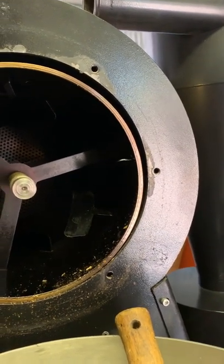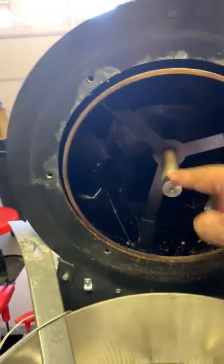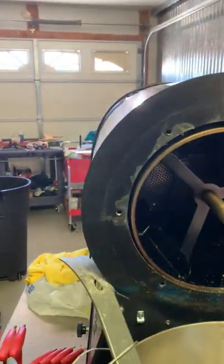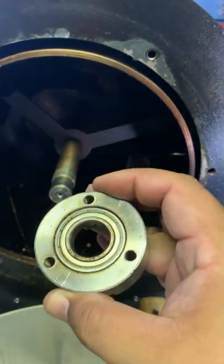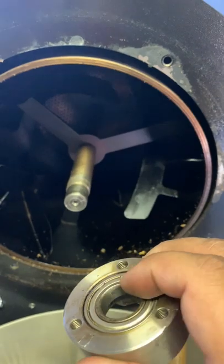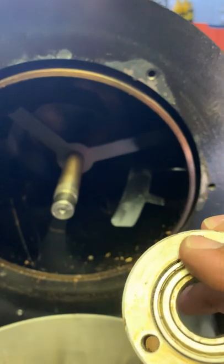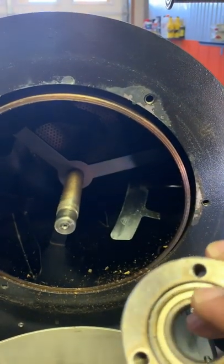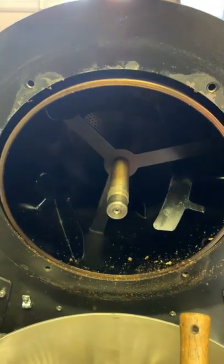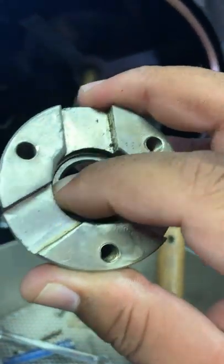On this particular piece right here — this shaft — there's a compression piece that I had a very difficult time removing, because I haven't serviced it in a while. If you service it every time you roast, probably within a couple of weeks or a month, the basic maintenance service means you're not going to have any problem removing this compression ring.